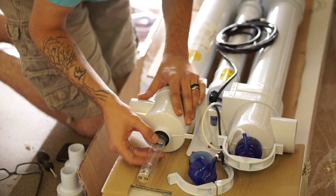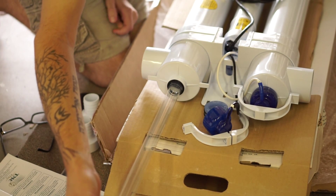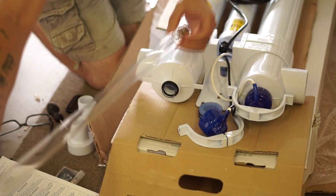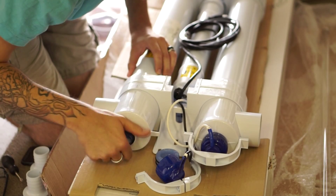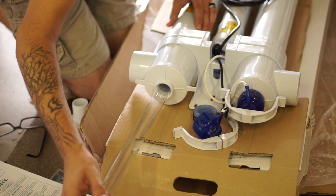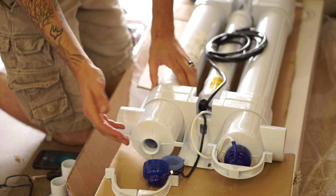This piece right here is going to just unscrew and then you'll have access to your bulb — it should slip right out. I can see the cord sleeve right here and I can also see the bulb. The 110 sterilizer takes two 55-watt high-output Philips UV bulbs. When you're pulling the UV bulb out, try not to touch the bulb to help extend its life as much as possible. The oils on our fingers can degrade it, but you can wipe them off if you do touch it. So it's a rather long bulb — be careful and make sure you have clear work space. Then take out the UV quartz sleeve, pulling on it gently. It's going to have two O-rings that make it sit right on the inside of the UV.